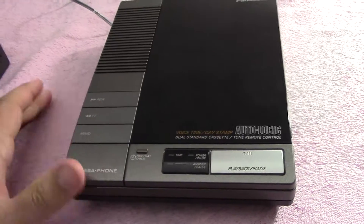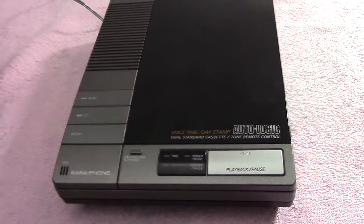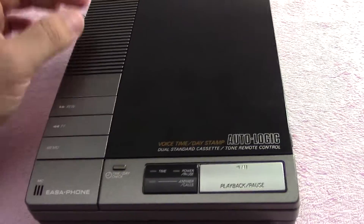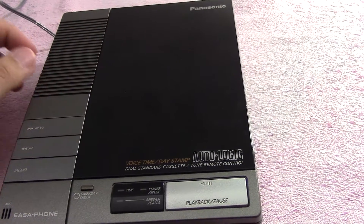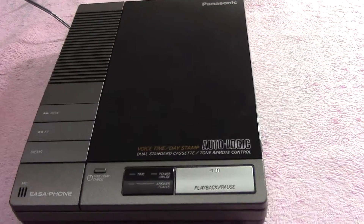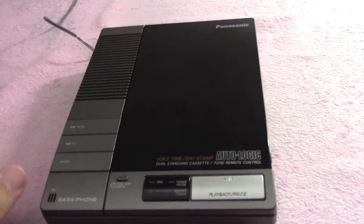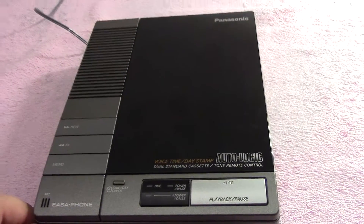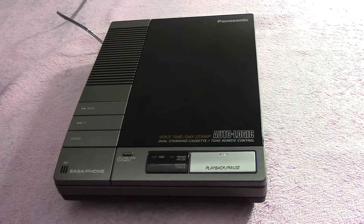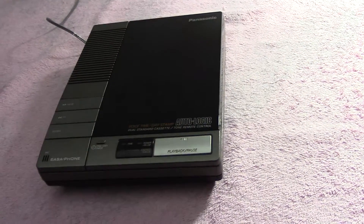Now this is not going to be the first time it's been plugged in since 2000 or 2001 — I actually did that last month, middle of last month, because I finally found the power adapter for it. My initial concern was that Spats Bear had made a video in 2010 of his 1970s Ampex tape recorder — it was mint in the box, never opened. But because it sat unused all those years, the belt inside that moved the reels had weakened from being stretched under tension so long, and the sound capacitors were bad too. But in my case, upon plugging it in and testing it, it ran perfectly. For cassette tape quality the sound still sounds very good, because it was in a dry room and covered all those years.